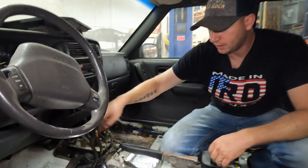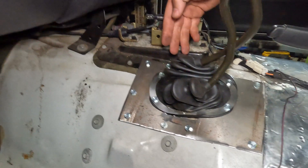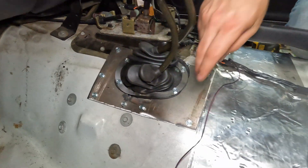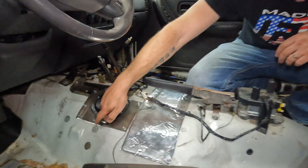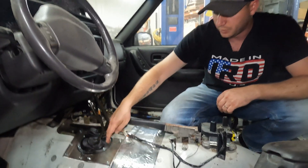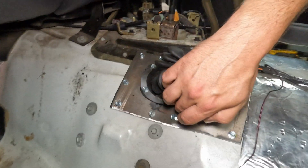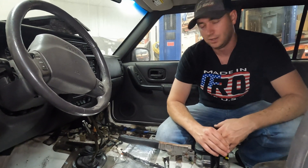We finally got our patch on. The last shot was the big hole cut in here — we had to go a little bigger to make sure we had room to get our side pins in. The patch looks bigger than needed but it's in 16-gauge steel — good and rigid but moldable. We ran a solid bead of silicone all the way underneath and used self-tappers to mold it in and provide good bite points for our seal. The floor in this thing isn't perfect, but we're not super concerned about water — it's a rock crawler, not a daily driver.